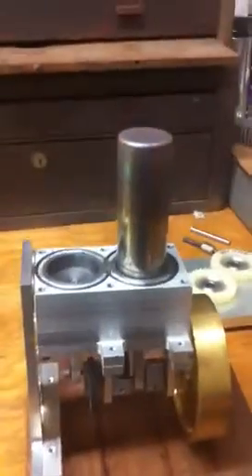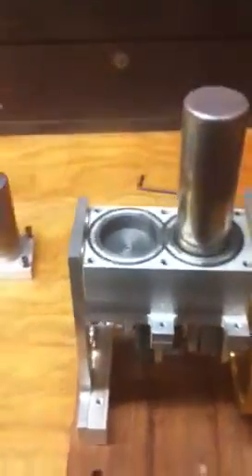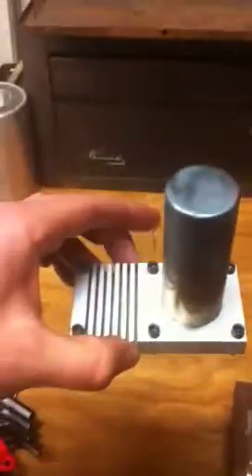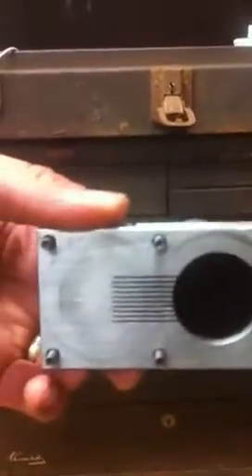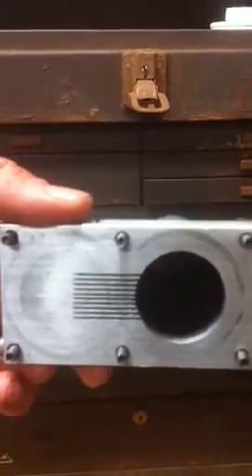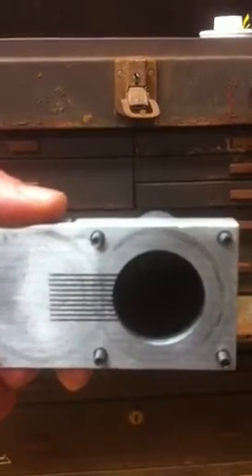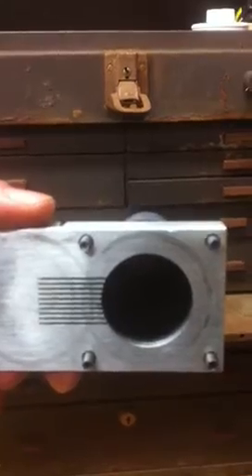You can see the heat discoloration from the heat transfer. The head has some cooling fins on top, and the air transfers through channels on the inside which are a hundred and ten thousandths deep by thirty thousandths wide, with an overall length of just about an inch.